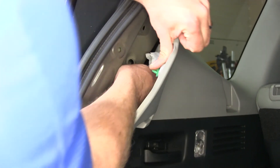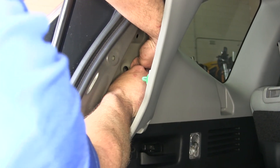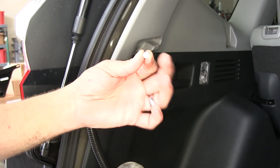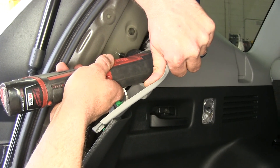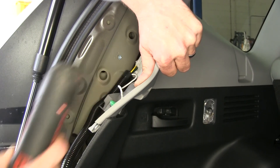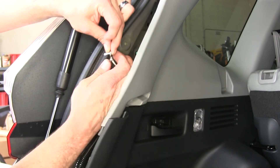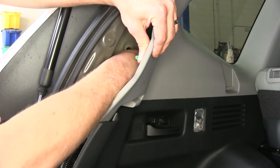We'll take our connector, match it up, and slide it together. You'll hear a click, and then you should push and pull on it just to make sure you get a good solid connection, just like that. Now we're going to use a small self-tapping screw — this one has a quarter-inch head — to secure our wiring. In a lot of harnesses that self-tapping screw is going to come with it; this kit did not have it provided. Get it started in a nice solid piece of body metal, place the ring terminal on it, place it back in there and secure it down. You don't need to over-tighten it, but make sure if you try to wiggle the ring terminal it doesn't move.